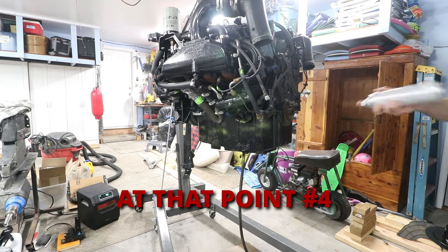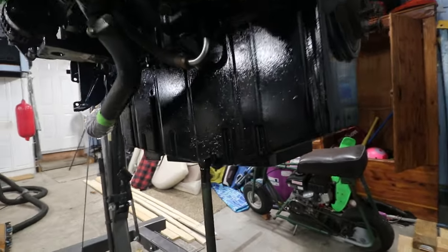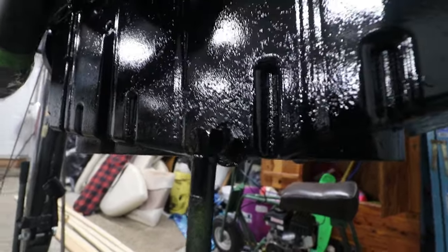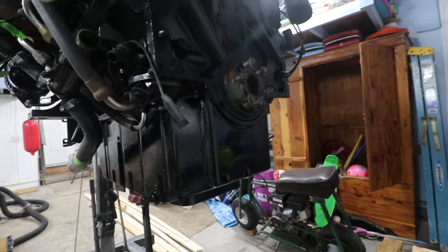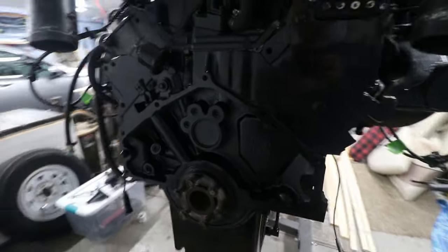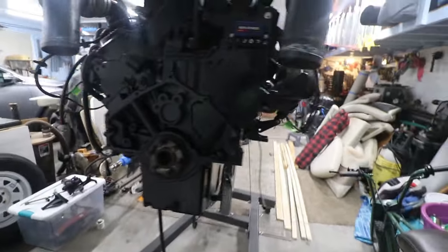So here's what it looks like. It's not perfect — the aluminum oil pan did have some corrosion and some pitting in certain areas, not deep enough that I was concerned with it. Overall, really happy with how the paint turned out. I also addressed some other areas of corrosion with the soda blaster while I was at it — namely back under the bell housing area, which had quite a bit of rust, and a couple of random rust spots on the underside of the block.